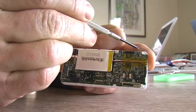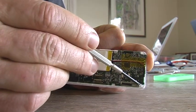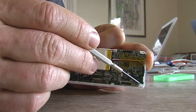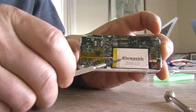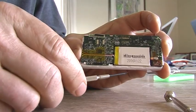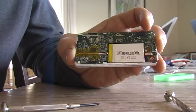You'll also have to pull these small white tabs back to release the circuit board from the front so that you can get all the way inside. Before you do that, you'll need to pop the battery out — you can just use a thin screwdriver to lift it out of its slot so the pieces can separate.